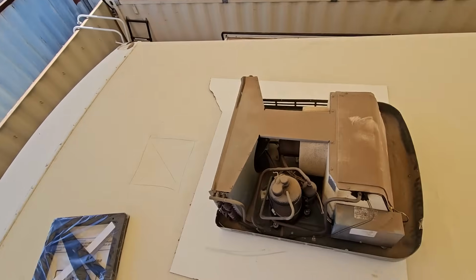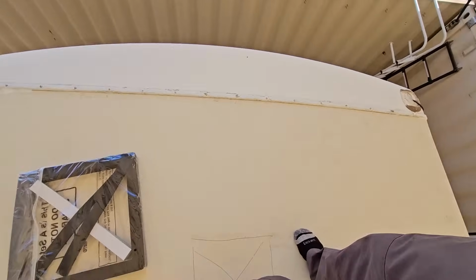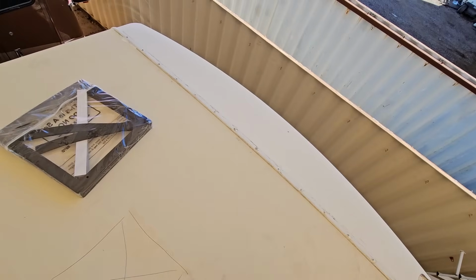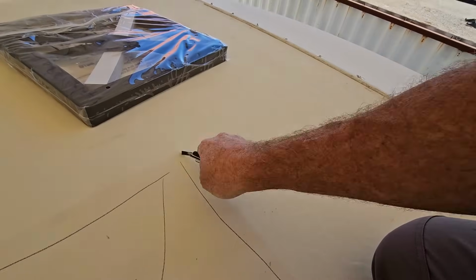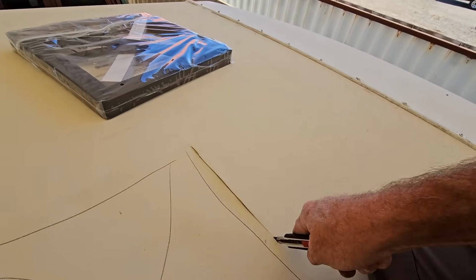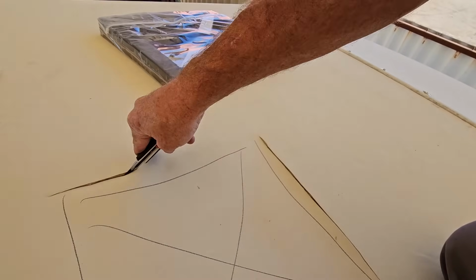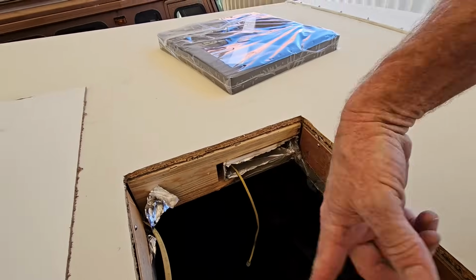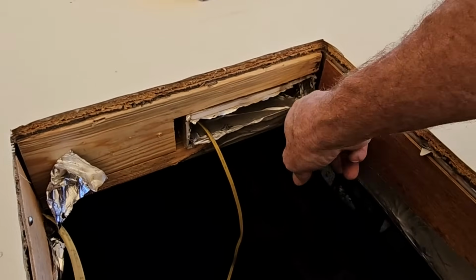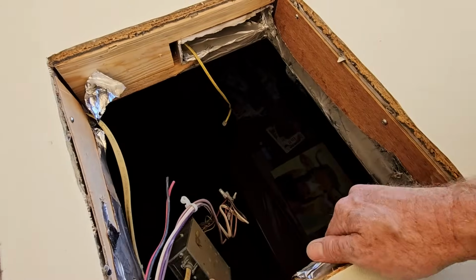All right, now really one of the last steps for me to do here is going to put the ACs back on. To do that, we do have to cut the material right here again, and this is definitely a spot where I do not want to have membrane flapping around. I know the manufacturer will have it like that, but this is the plenum box and the air box, where the air will be cycling and circling around in here, going into the ductwork right here. And having those things flopping about will cause some serious problem.